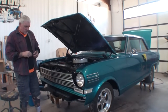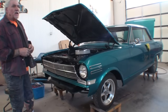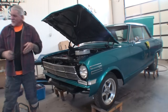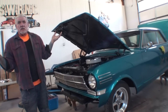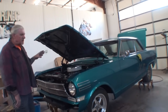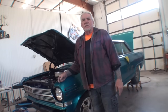Getting a car restored in this day and age is very hard. I'm going to contact the owner and see what he wants to do. I looked up the rear wire harness — it was around $280 just for that. I haven't even looked up the front one yet. Once you start buying harnesses, the problem could also be under the dash — you just don't know. On a vehicle like this, I don't suggest an aftermarket hot rod wire harness. I suggest getting the factory wire harnesses.